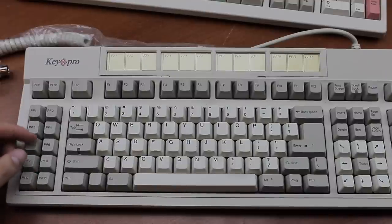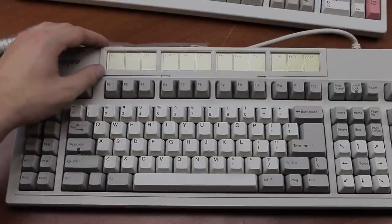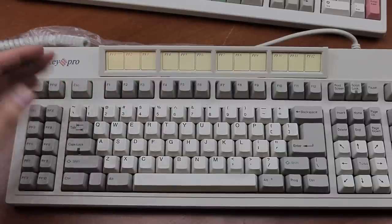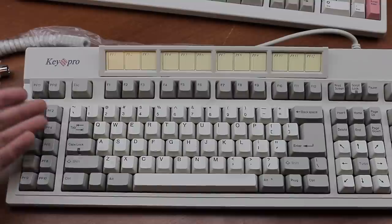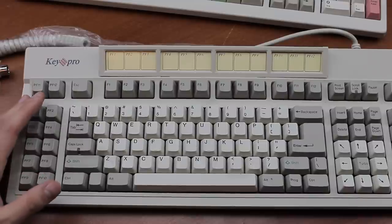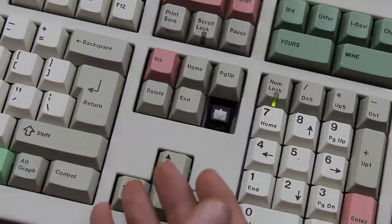They can only store a dozen or so inputs per key, and there's no separate layers for them. And although there is a nice little repositionable shortcut card holder for you to write your macros on, it's of course not as nice as a screen that keeps it up to date for you all the time. The Focus also only had 2-key rollover, while the 9009 has full N-key rollover. Considering the Focus was a consumer product with a relatively low-budget price tag, and the 9009 was custom-made for a massive company, I wouldn't be surprised if the 9009 cost 10 times as much as the Focus, but the difference in quality is obvious.